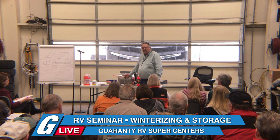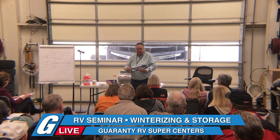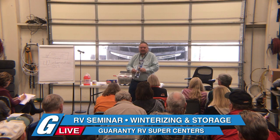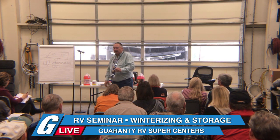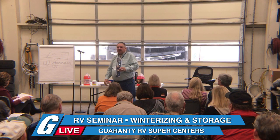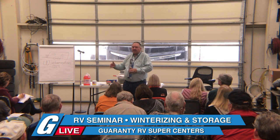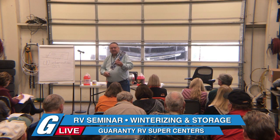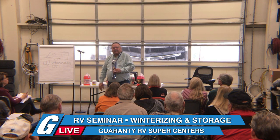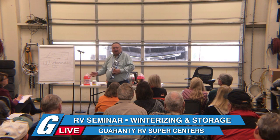If your coach does not have this really cool bypass kit, your local RV dealer can sell you one. And this is a really nice kit. We sell some not so nice kits, but this is a really nice kit. Somebody that can run a crescent wrench and turn this stuff and get down on their knees can do it. This is not that hard to do. If you get to the back of your water heater with it depressurized, you can install this. It's two valves and a bypass hose. They work really good. If you're going to pump it out, you definitely want one of these. If you're just going to blow it out, you really don't care.